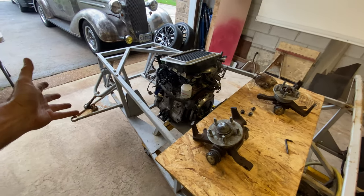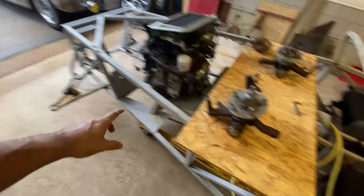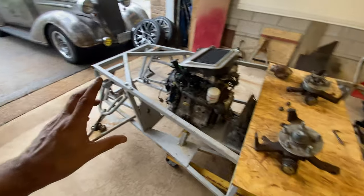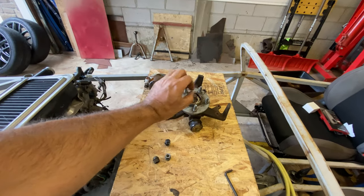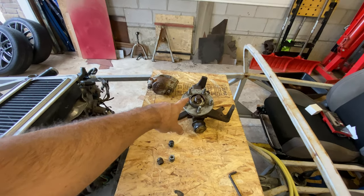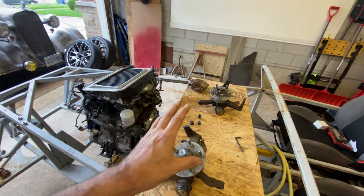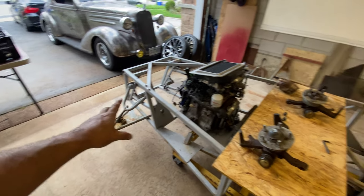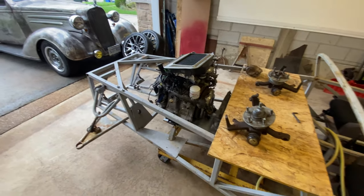So we have almost everything we need to assemble the front. I've got my spindles, I've got my hubs, I've got my control arms. There are even nice new ball joints which need to get pressed in. However, I am missing a couple of things - I don't have the big nuts that go on there, and the washers as well - I forgot to order the washers. The nuts will be here tomorrow, possibly today. Also obviously going to need brake discs, but that's way down the line. At least I can get this all together on the control arms, and once I get the hubs I can put the wheels on. That will be a job for tomorrow.